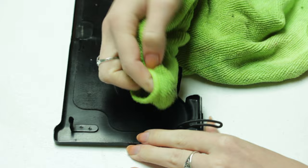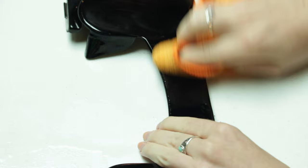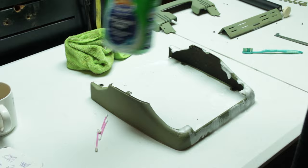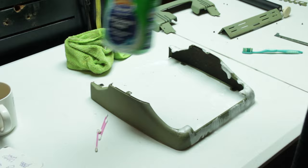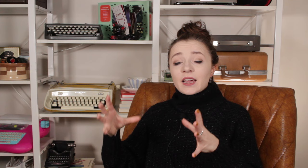After you patch test, you can go in and clean the panels. This is also why I suggest taking the panels off before doing internal cleaning — it's easier to clean them when they're not attached. The external panels are the metal or plastic pieces on your typewriter, and you can use a myriad of cleaners. A lot of people can just use soap and water. I've also used Simple Green, Scrubbing Bubbles, and LA's Totally Awesome cleaner, and on shinier glossy black finish machines I've also used car wax — in most cases these products have worked pretty well for me.